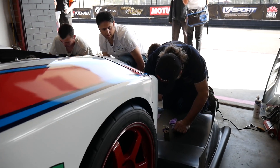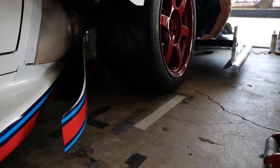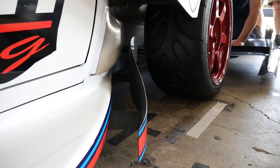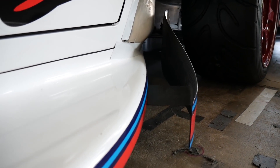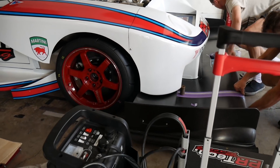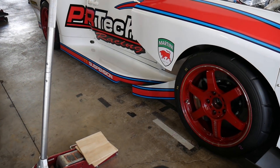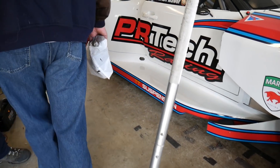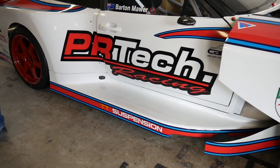Moving back on the car, we have a set of barge boards — very rare on a time attack car. Are these generating vortices for the floor or just directing out the tyre wake? They're doing both: pushing dirty air from the front wheel away from the floor, and in the process generating a vortex that directed underneath the floor creates local suction gain. The side of the floor has quite a thick, squared-off section with a radius and an inlet — what's the logic versus a thinner plate? Having a large leading edge radius is important to maintain flow quality underneath the car; the total thickness is probably just a function of available development time.